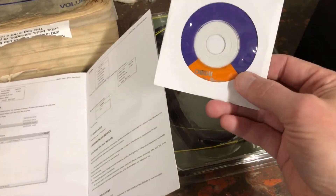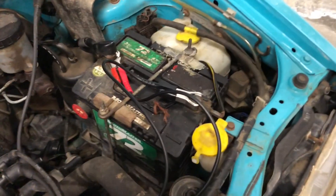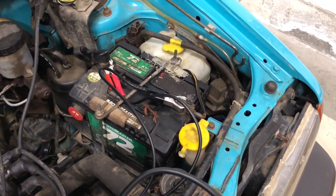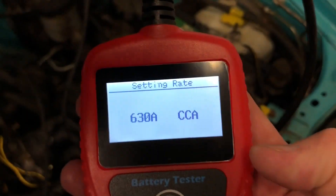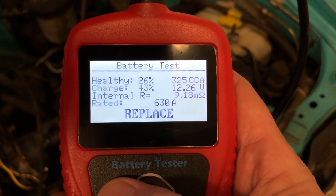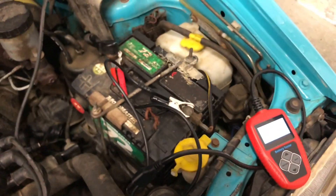There's a CD in the package and you can actually plug in a USB cable that comes with it and you can print off that data, which is kind of interesting. I have one more battery I can test and you'll be interested at these results. This battery has a date code of June 2010 and it's now February 2018, so that's an old battery. The cranking amps - health is 26%, charge is 43%. Replace. It's putting out in the neighborhood of half of the amps that it should be. You can tell by looking at this that it's not in the best condition.